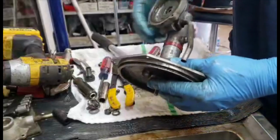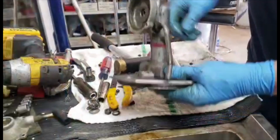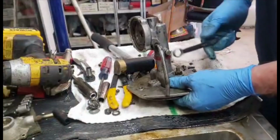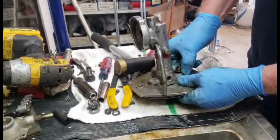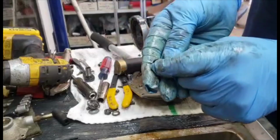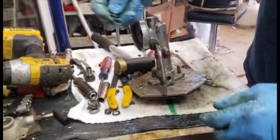Alright, look at my vise, I unscrewed this one. It's a 14 open end wrench. One at the bottom, 14, and you can use a box wrench or an impact if you got it. And the washer under here is a flat washer. It's a special washer. It's slightly thinner than a regular 8mm washer, and it's slightly smaller OD than a regular 8mm washer.